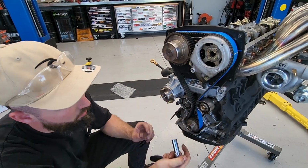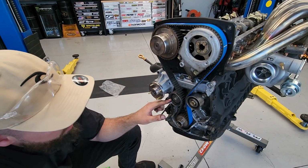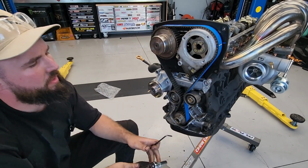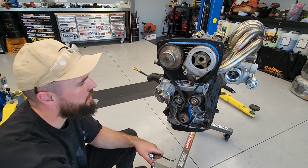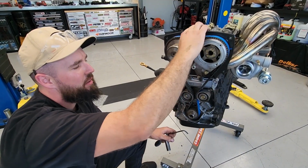These 2 pulleys are new, by the way. So there's a spring behind this pulley. This is a tensioner pulley. So then we get our tension desired, nip it up. Then we've got to turn over the engine a couple times till we get our markings to line back up. And then we check the tension again, make sure everything's okay.